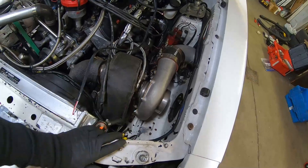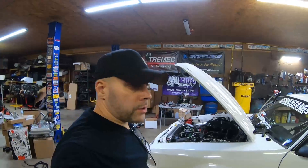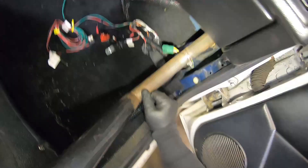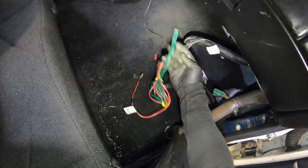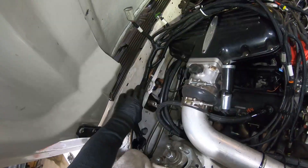Got power and ground hooked up at the battery — not much different than if you had the battery in the stock location. We're going to mount the seat; the Terminator X is already mounted to the seat bracket. We're going to get under the dash, bust out some wire clamps, get it tucked away, and work our way into the engine bay. Got a couple connections to make. I want to make sure the harness is long enough — I'll do the key-on, engine ground, and fuel pump relay, then run wire loom clamps.